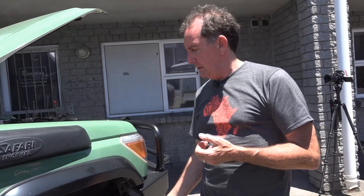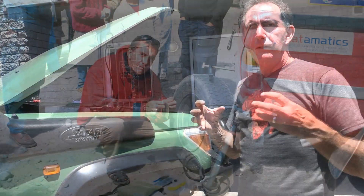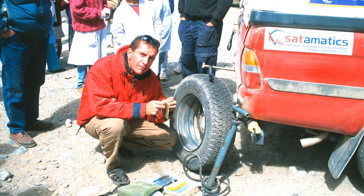So you lower the tire pressures. When you're lowering tire pressures, you've got to manage the heat buildup in any tire. So you're going to limit your speed. We have a tire monitor in this vehicle with little sensors in the tires. They'll manage heat and tire pressure, which is a great safety feature because heat is a critical factor. You lower tire pressures, the tire is flexing a lot more, and you can quickly build up to a point where you can burst a tire.